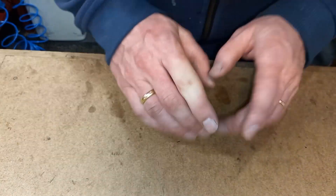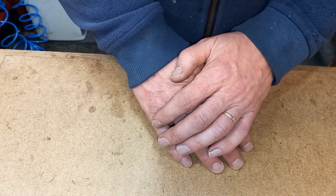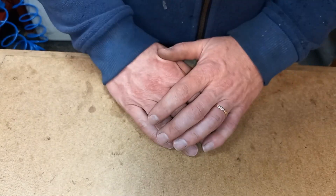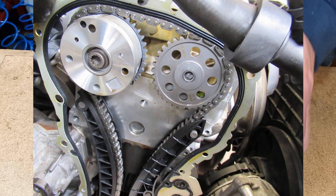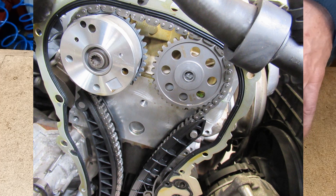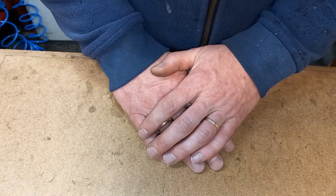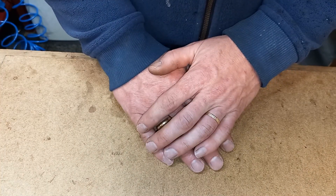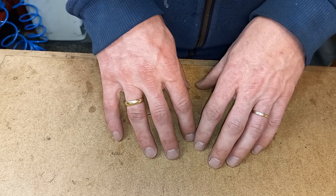To conclude this video, I wanted to share a story from my day job. A couple of years ago, I got a call from an insurance company to investigate a damaged engine. A one-man workshop had installed a new cylinder head and timing chain kit on a 1.4 engine in a Volkswagen. The timing chains in these engines are known to stretch and can cause severe engine damage — which had been the case on this Golf, damaging all the pistons with no undamaged valve in the cylinder head. The engine received new pistons with improved oil scraper rings and a brand new cylinder head.